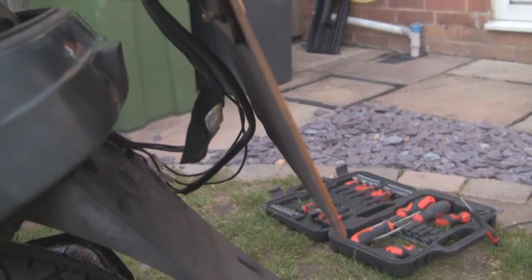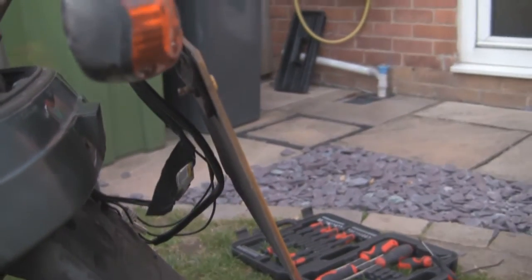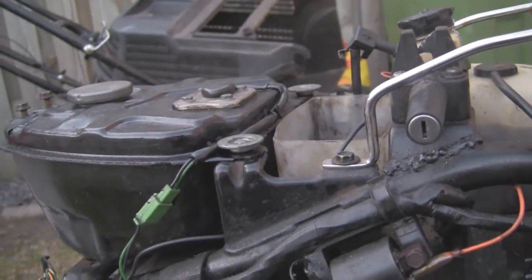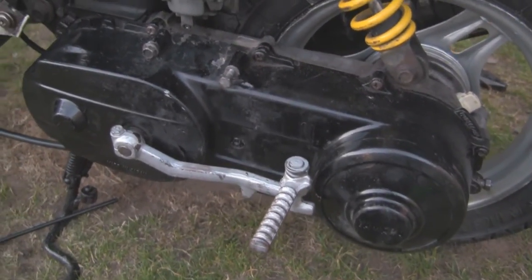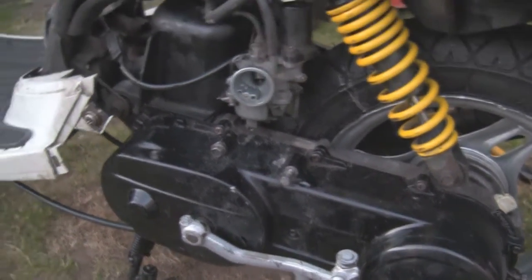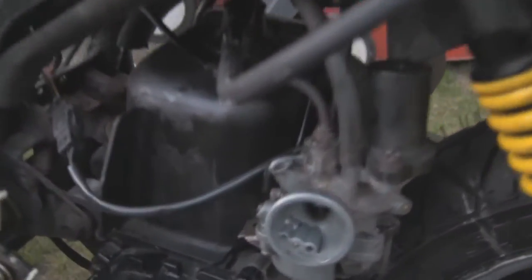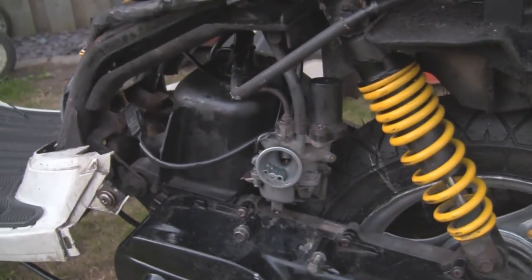So I've got some panels to put back on, and I've also got these wires to connect up on the back of the lights — I don't like the connectors on there, they're a real mess, so I'm going to cut those off and crimp them up and put them back on. I've got no battery at the minute because I've flattened it messing about with things, so I'm charging that up. But just with one kick it's kicking off really nicely, going straight onto idle and revving up properly. It actually runs at full throttle with no problems whatsoever now, because I've got that inlet manifold gasket on the back as well. That's all working right — new plug. So so far we've done well.